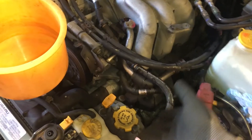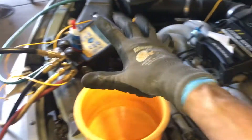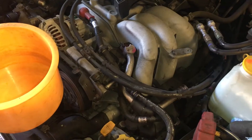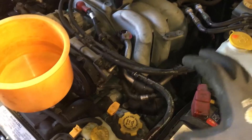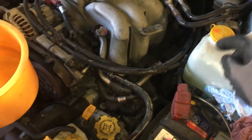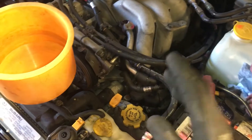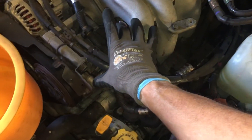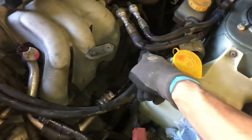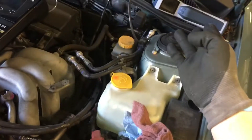What I'm trying to do is duplicate the failure mode at which these leaks occur so I can catch it on video. Otherwise, I would just say: you're replacing this hose — it only had 30 psi. I'd cut it off right there and tell the customer we're changing these o-rings because we know they always leak, and changing this hose because we know it's leaked. I don't even need UV dye or a refrigerant detector — it couldn't find anything right now.